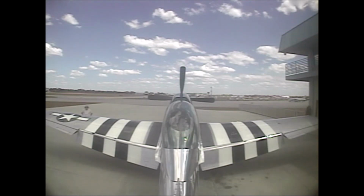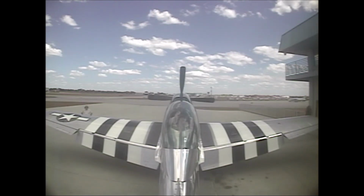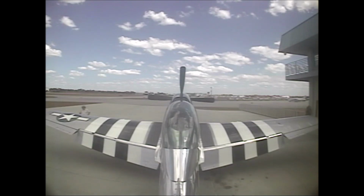All right. Parking brake is in, oxygen is off, hydraulic T-handle goes in. That activates the hydraulics. I got 2 warning lights because the engine's not running, 30 inches of barometric pressure, and 24.8 volts. I am going to have to bring this seat up further though. There we go. Switches are off, circuit breakers are in. All right.